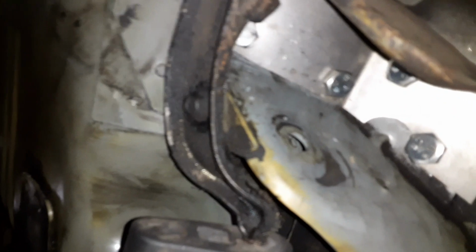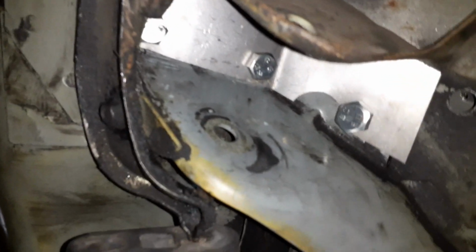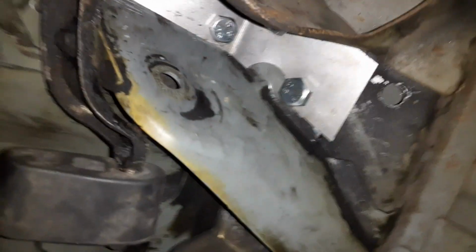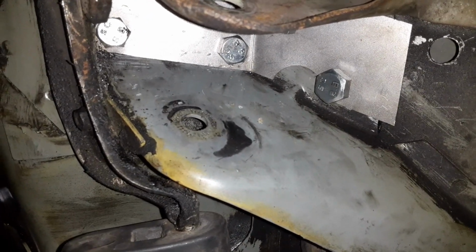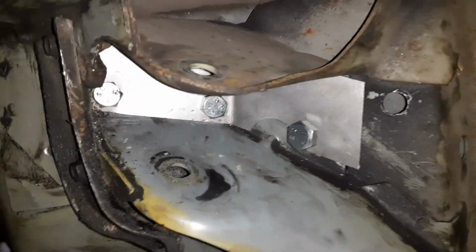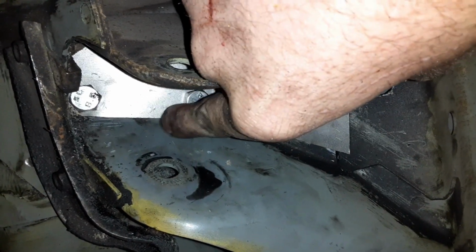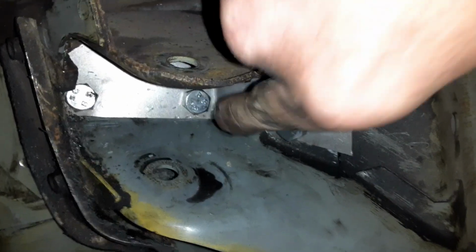On both sides, we got all four of the bolts in. Like again, on the top, you got to drill and wiggle and drill and wiggle. To get those bottom holes, drill, go ahead and snug the tops up. Drill all the way through the frame with these. You got to have somebody inside kind of pushing on the plate. Mark you some spots on the inside plate. And then you'll have to pull the plate out of the car and drill the holes. But we got those in.